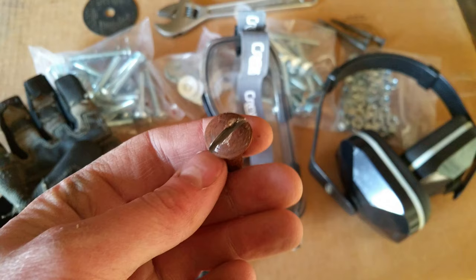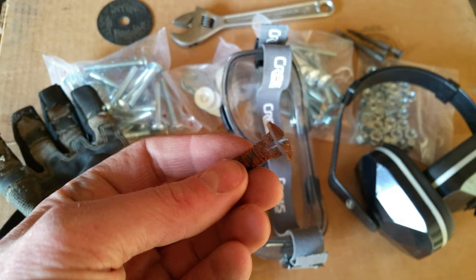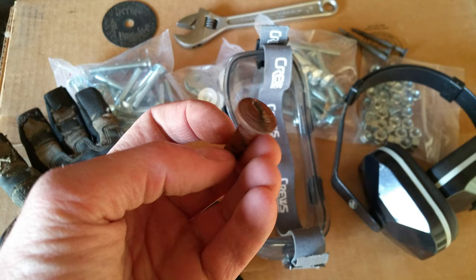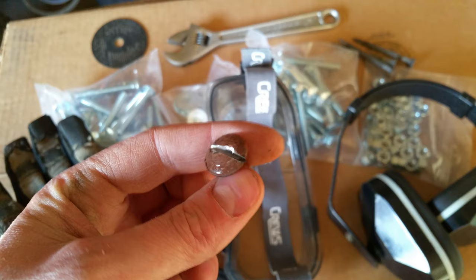So all the old carriage bolts were actually kind of a pain to remove. They didn't snap off or come off cleanly. They just spun the head. So what I did is I took a grinder, ground a little slot into it, then had someone else hold a flathead screwdriver on it with a crescent wrench, to make sure it didn't spin. Then I was able to either snap the bolt off like this one or just spin them off, and then I could get the boards off.